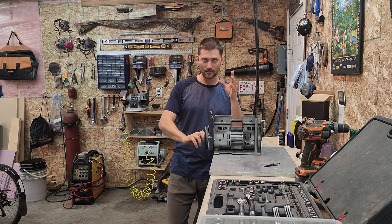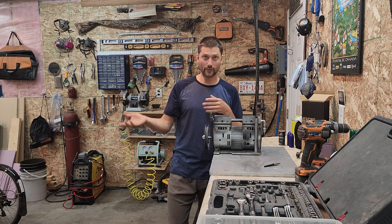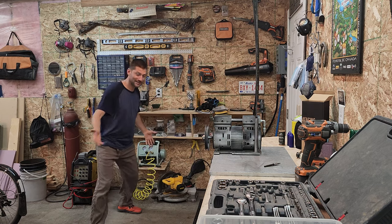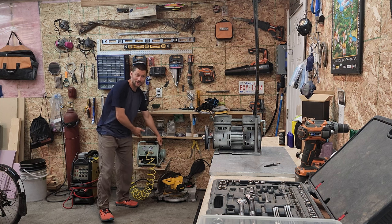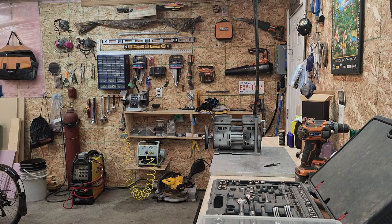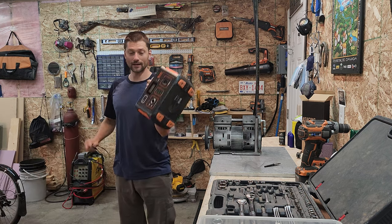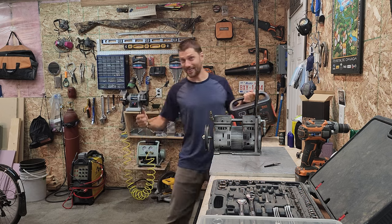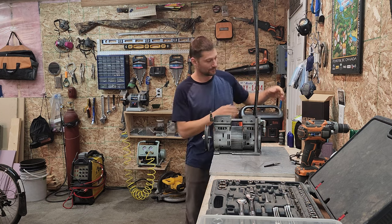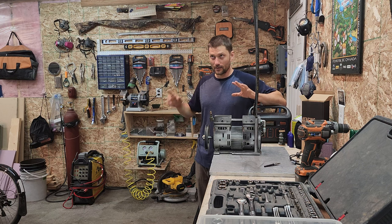Mohammed the Gold Fiddler posed a really interesting question - he said why not just a generator and the compressor as it was. That little air compressor back here will run off of my Jackery which I've got right here. This is fairly lightweight and it's 500 watt hours. That little air compressor pulls 250 watts, which means this will run for two straight hours, and I've tested that air compressor not underwater.